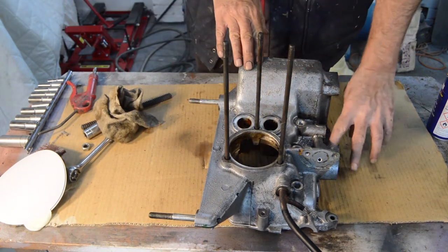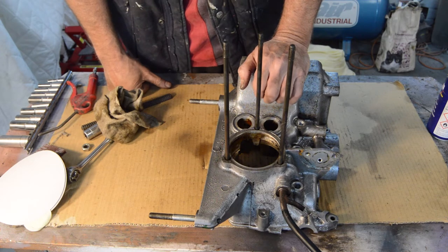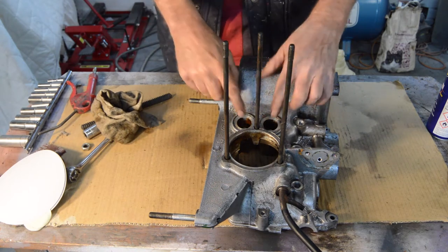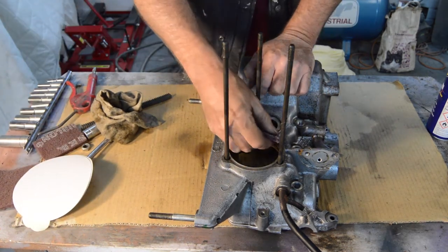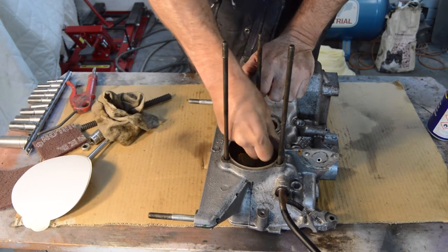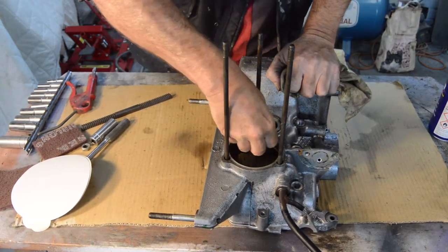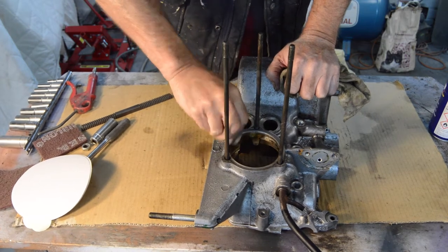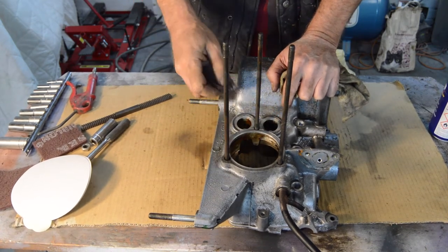It'll be thoroughly washed and blown out with an airline to make absolutely sure there's nothing nasty lurking. I won't be going for a perfect finish on the case - you'd have to vapour blast it to get it looking perfect, or clean it and paint it with engine silver. I won't be bothering. So we need to make sure that's clean where our spectacle seals sit and where our cylinder sits. A bit of Scotch-Brite first, because it's non-damaging. Most of the time it does the job perfectly, and you're not putting grit anywhere near your engine using Scotch-Brite, which is why I like it.